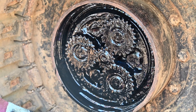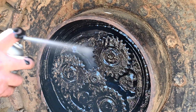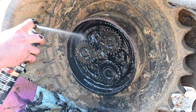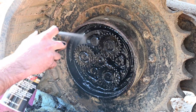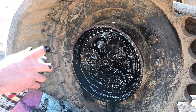Anyway, I'm going to show you what we can. You're going to take your brake clean — make sure it's chlorinated. There is a bearing right here, so keep that in mind. Get all the sludge out of there — it's going to take a while. Eventually it will start to look better. Clean the planetaries and the bearings.